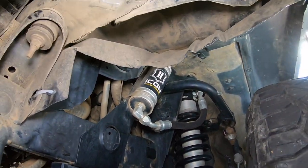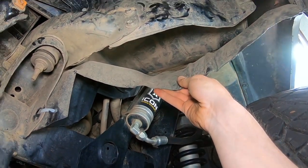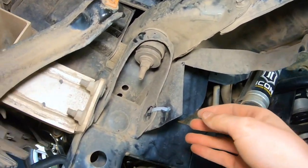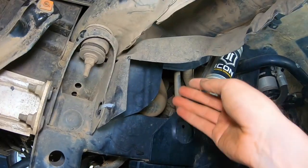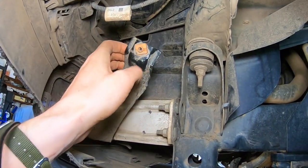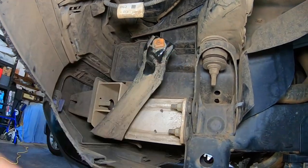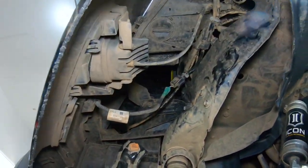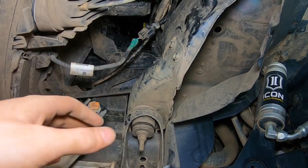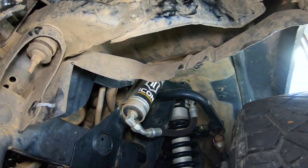I put you away for a little while — I just wanted to try to clean this up and knock it out, speed things up a little bit. Let me give you the final result on the passenger side. I wasn't really able to save too much of the wheel well liner unfortunately, and I did have to cut a good portion away, but I did still leave a good portion on there just to prevent some of the splash up. I was able to drill a couple holes and throw a zip tie through, so that spot will also protect that engine opening. The aluminum bracket is just pushed and bent up out of the way — that was pretty easy to take care of. For my Baja Designs fog lights, I did reroute the wiring and zip-tied those up into a couple little spots here, so a nice clean look with some slack to allow it to bounce around. Really happy with how this turned out.